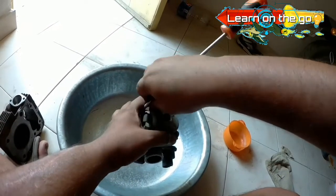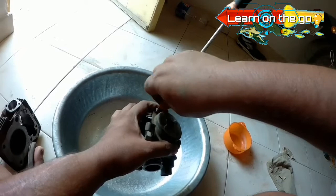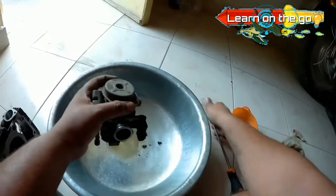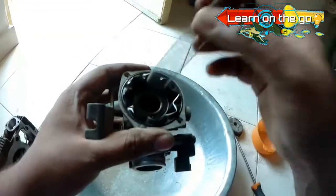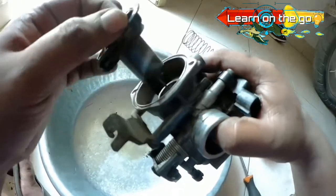At the top of the diaphragm, there is a diaphragm retention spring, and that's why you should take special care while you are taking out the last screw. Usually there is very little dust retention at the top of the diaphragm, and in our case also that's the reality, as there is little space for dust to get into.